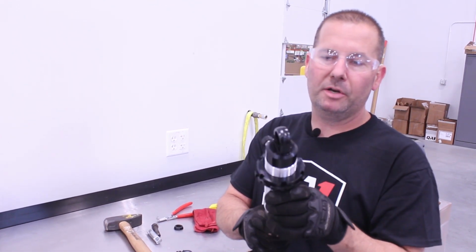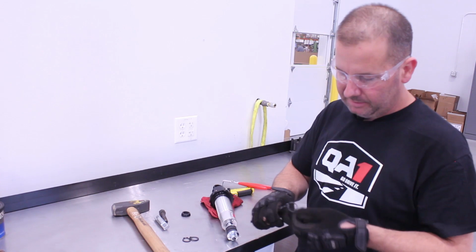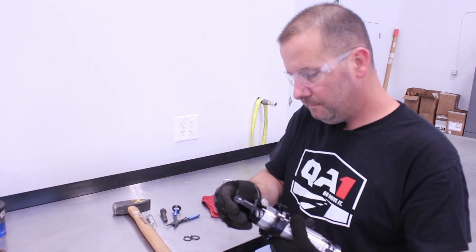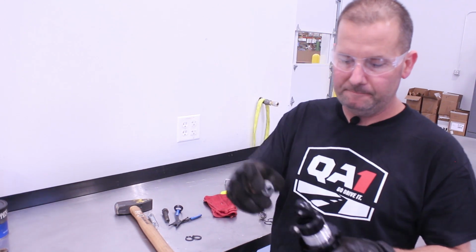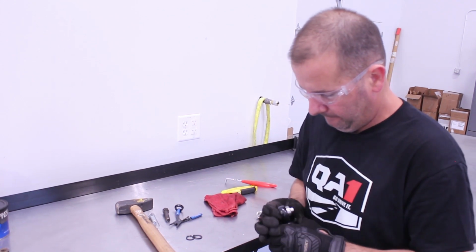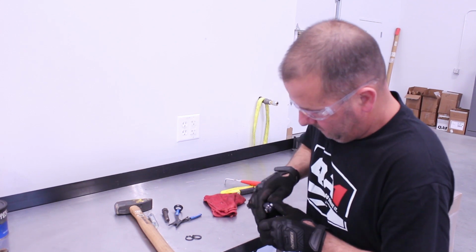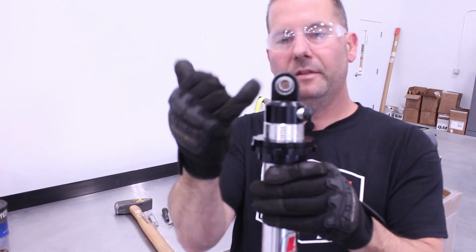So now once you get the eyelet bare, you'll see internally there's 2 grooves where our snap rings will sit. Pliers, we're going to set those up with the internal C-ring there, and that will sit into the groove. Make sure that's good and seated. Then we'll push our bearing in from the opposite side. And it can be a tight fit. There we go. So now you see the bearing is in. It's got a C-clip on this side. We just need the final C-clip over here.